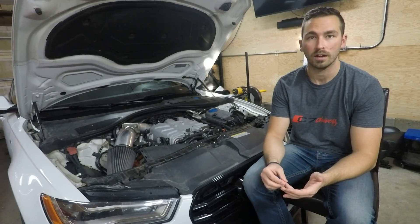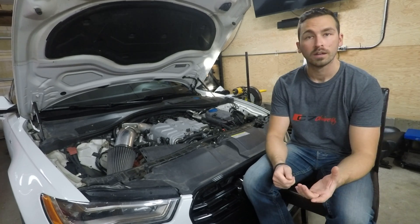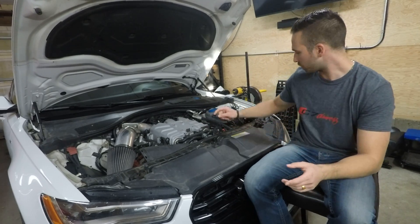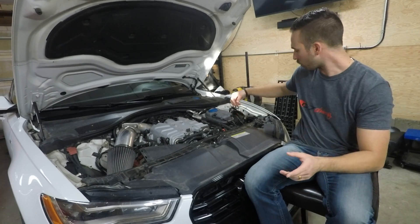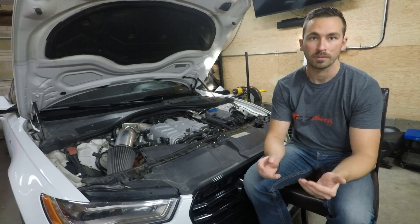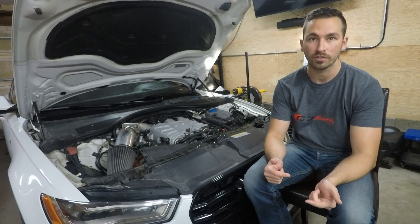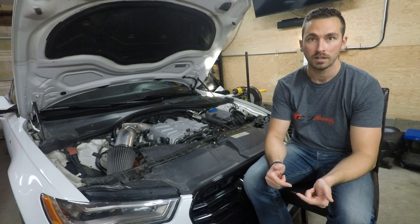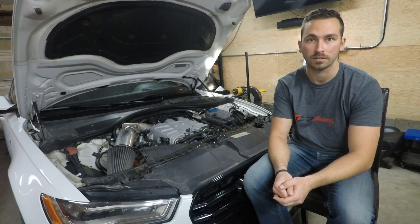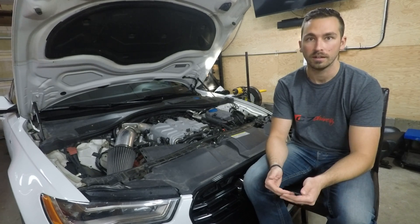A really good divorce system would have a spot to use an OEM electrical plug — it's underneath this reservoir. It would tap into that wiring harness, and the divorced reservoir sits about here. So if the level gets low in the divorced reservoir, you'll get a notification on your dash. It retains that OEM function so you don't run your loop low — say by accident a hose fails or leaks.